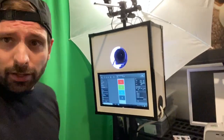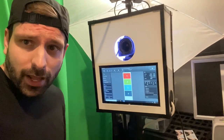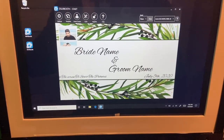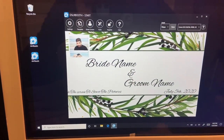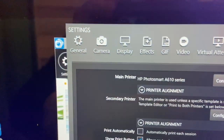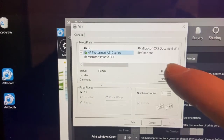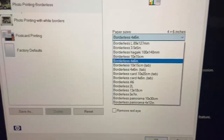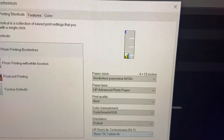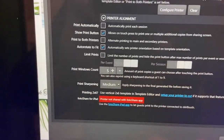I've got the photo booth program on the template set to print a 4 width and 12 height. You just go into Orientation, click Vertical, then change the width to 4 and the height to 12. One more setting you have to do with the HP A616 is program the printer preferences. Go to Settings, then Printing, configure the HP Photosmart A616, go to Preferences, and change the paper size to 4 by 12. We see 'Borderless Panorama 4 by 12 inch' right at the bottom — click on that. So there we have it, Borderless Panorama 4 by 12. Save that, press OK, apply, and press Print.